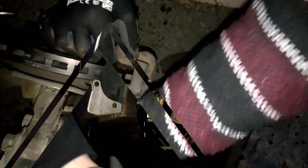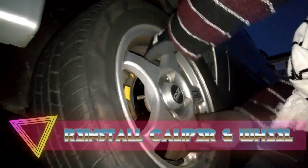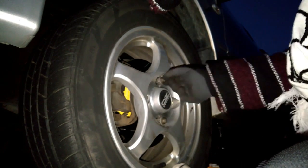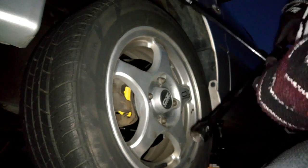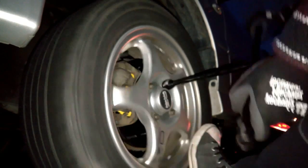After this it's pretty straightforward — all you're doing is putting the bolts back in and putting the tire back on. And that's all there is to it. Once you get this on, definitely take your time breaking in the new pads as well as the rotor itself. It does take a bit. And of course, use your cross-diamond pattern to get your tires back on.